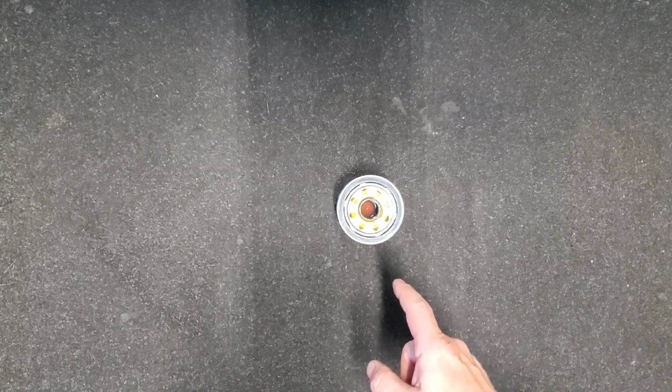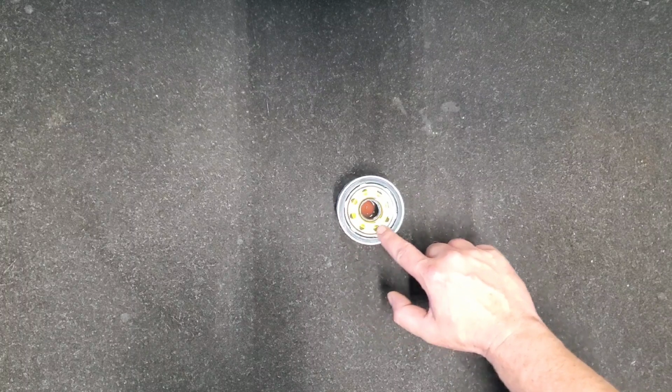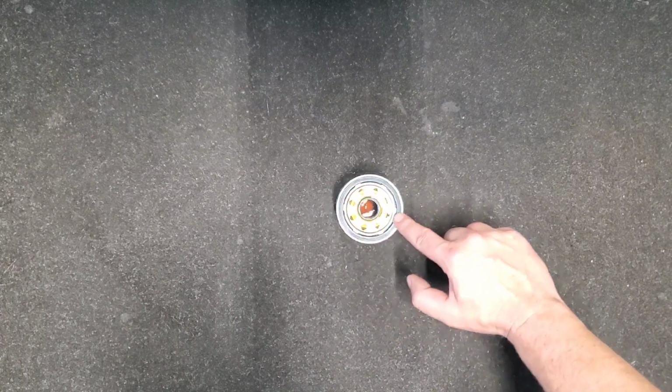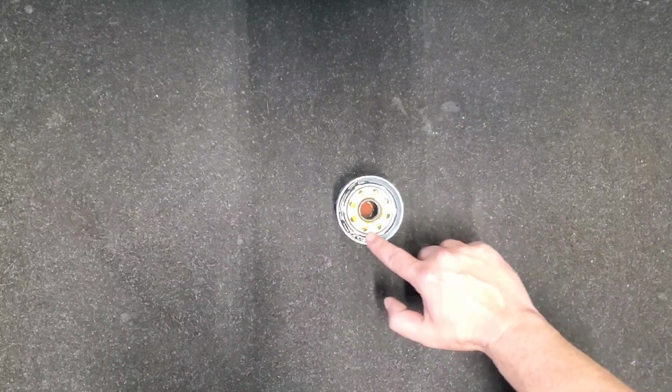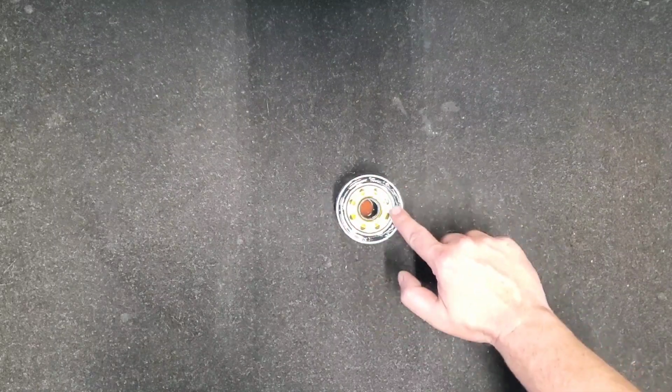And then once you have your oil filter filled, just take a little bit of that oil, rub it around your filter gasket. Just kind of lubricate that up a little bit. And then go ahead and put your filter back on by hand. You don't really want to use the filter wrench on that, because once it expands from the heat a few times, you'll never get that thing back off, and it'll be a pain in the butt.